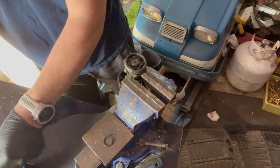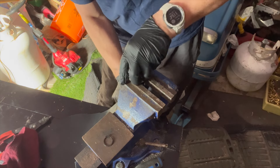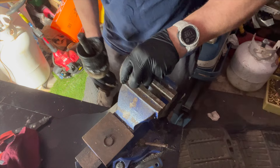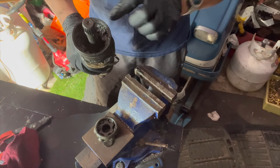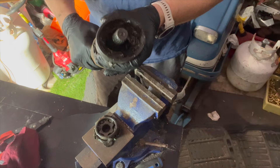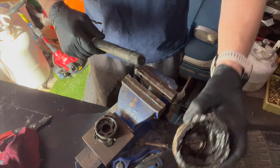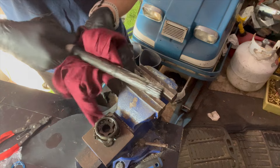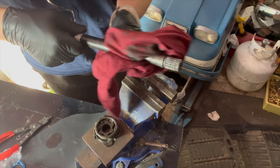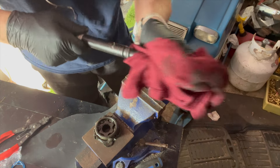I don't want to lose my balls, so I've got a quick idea — let's loosen this up and look for the old slide hammer. So now that's off. Your little clip is still in the boot — set that aside. Slide your old boot off just like that, and slide the tape off. Grab a rag and polish your shaft nice and clean. Clean shaft — now we'll get the new boot and reverse this process.